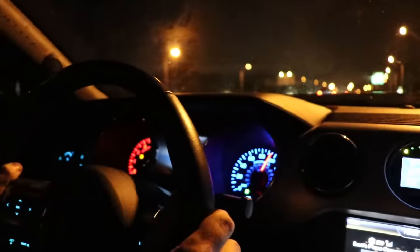Scott, what are your first impressions on this ship? I am so incredibly stoked with this setup. It rips. It's probably making about 450 wheel right now. That's what Alex was thinking. And 28 degrees of timing with no knock at 8150 RPM, which is just ridiculous.